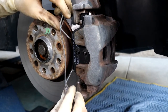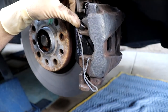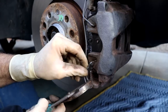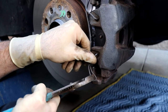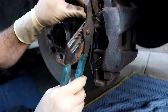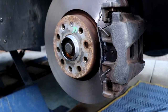One last thing before we get the wheel back on: we're going to put our little retaining spring. I like to get one side in, then take a pair of channel locks and give the bottom end a little tweak, then just tap it in flush. You want it to be touching here and here. Now we're ready to put the wheel back on.